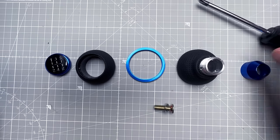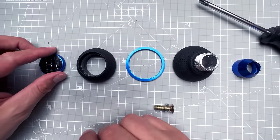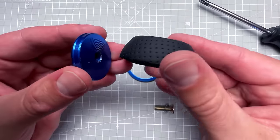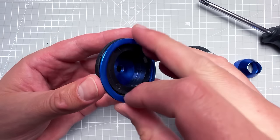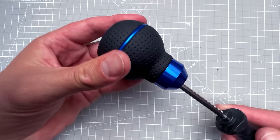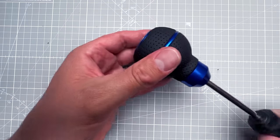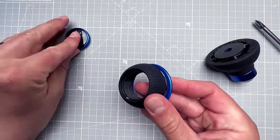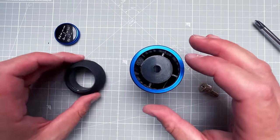The first step was disassembling the AliExpress knob. It's made from five different pieces: an H-pattern disc, the top half of the knob, a small ring between the top and bottom halves, and a bottom cap. Inside is a small bolt holding everything together from the bottom all the way to the top. Since I know very little about 3D printing, I decided to keep this as simple as possible — using most of the original parts and just 3D printing the top half of the knob.